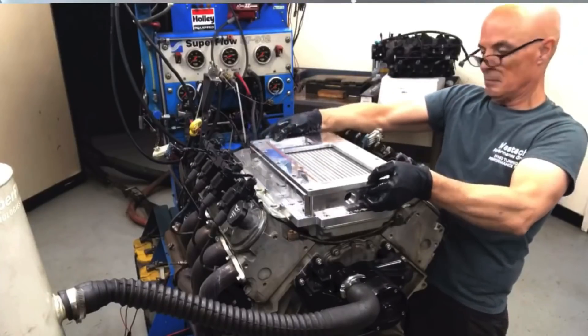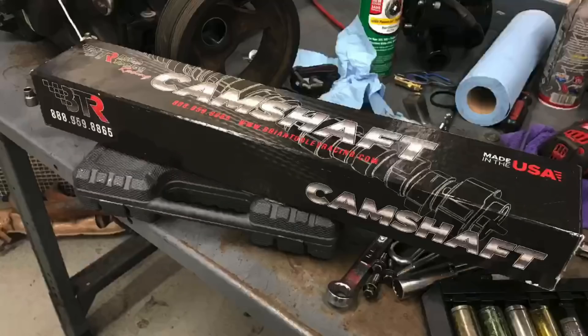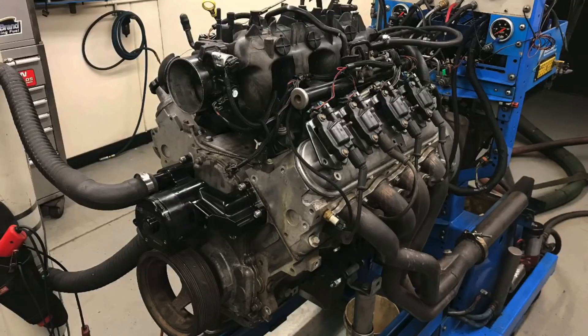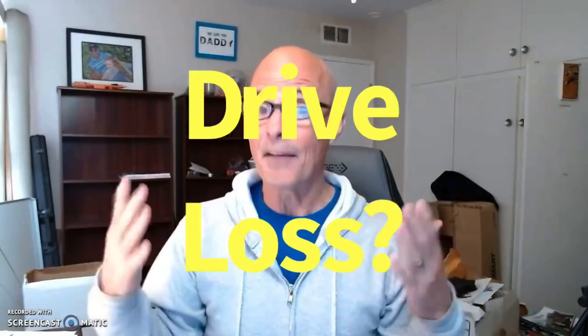Hey guys, I'm Richard Oldner and welcome to the channel. Today we're looking at Part 4 of our supercharged LS. We have our Demuse Engineering adapter kit that allows us to put a GT500 — or in our case a 5-liter Coyote TVS blower from Ford Racing — on our Truck Norris cam 5.3 liter. Today we're going to look at two important questions: first, can you use the bypass valve to put this supercharged combination into valet mode by reducing the boost? Second, how much power does it take to actually drive the supercharger? If we're making 700 horsepower, how much more power would we make if all of that boost was free?